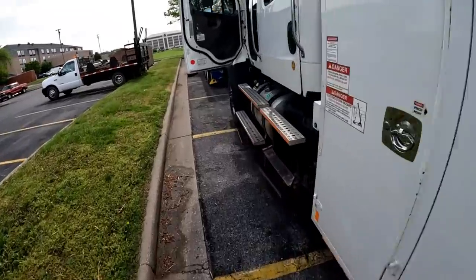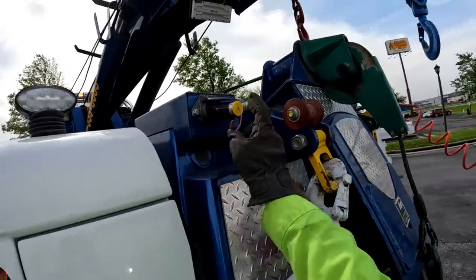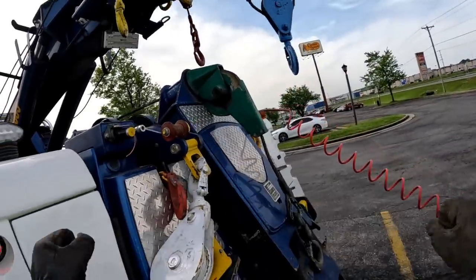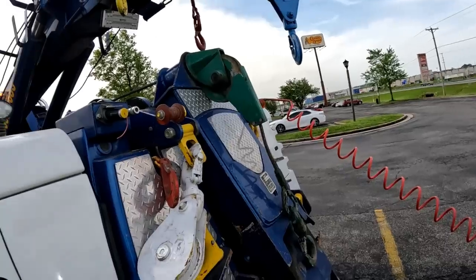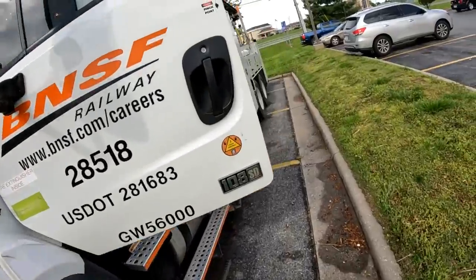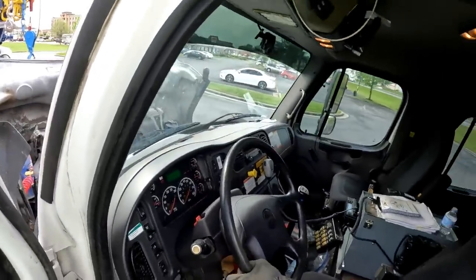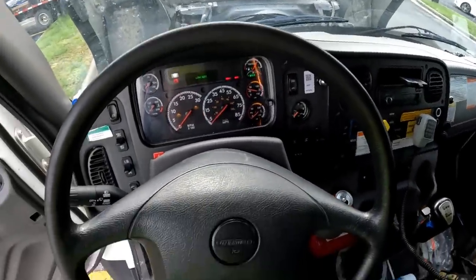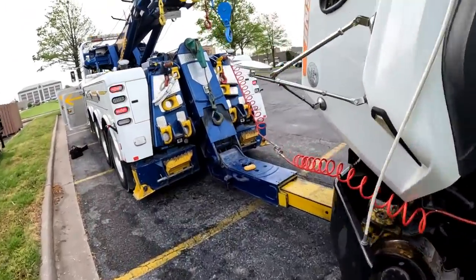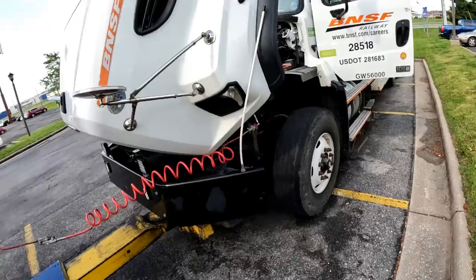I get a lot of people that ask, how is that controlled? This transmitter right here plugs into the standard 7-way, so that if we had a regular trailer cord, we could hook up. We used to have to run the old long cords all the way to the back of a truck. Now it's all done wirelessly. The bar still has a manual plug so that you can, okay, the air's coming, it's just taking a little while. Still has a manual plug so that if something should happen to the transmitter, you can still plug it in with the standard wires.